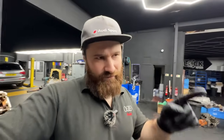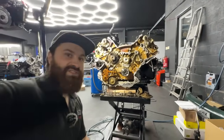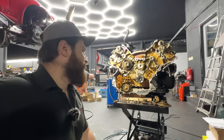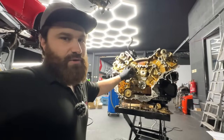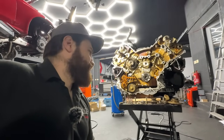The other BBK engine over there will be a full job — the owner wants to keep the vehicle as a future classic, which is probably a good idea because it's a quite rare color, British Racing Green. The BBK engine was in a similar condition — all the plastic guides and everything were broken inside. The camshaft adjusters were completely worn out — the hole in the camshaft adjuster has a 45-degree slope and the pin was just moving itself out whenever it wanted. There were loads of fault codes: incorrect correlation, all the adjusters showing bad duty cycles.